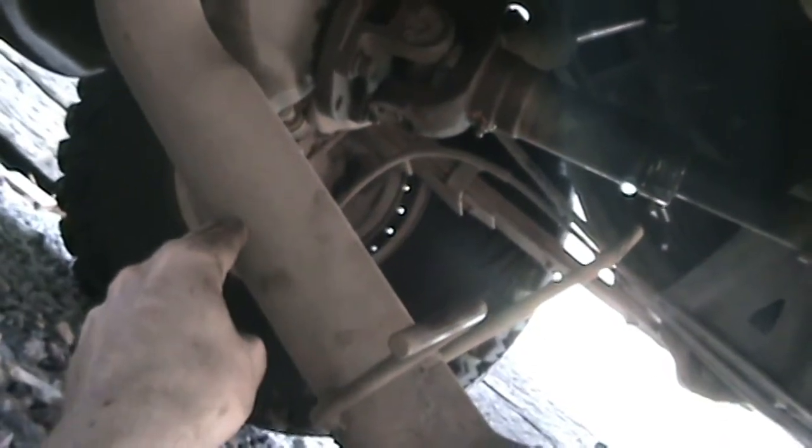I'll make the cut and then weld on the flanges, because this side will be kind of supported, so it'll be easier to just do one cut at a time. And then I'll cut our flanges on it, and I can actually completely remove this once everything's tacked in to get that final flange on there well. And same for the muffler portion as well. And then I will re-weld these guys on, and again I can get those welded on good and take it off.